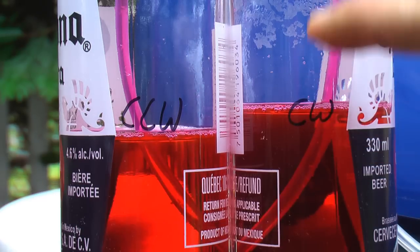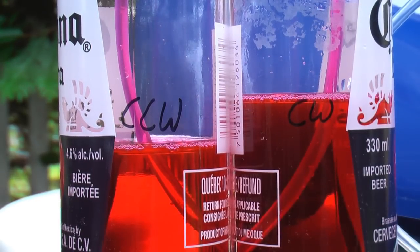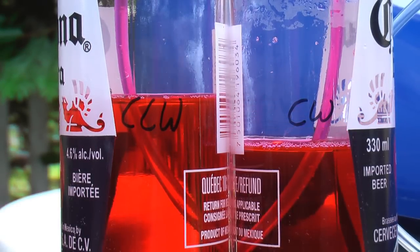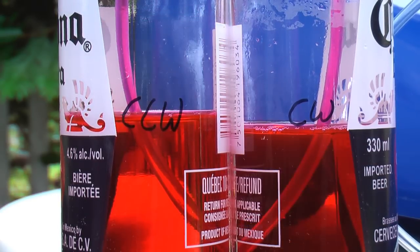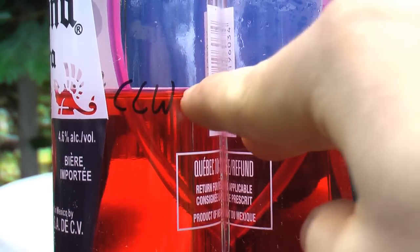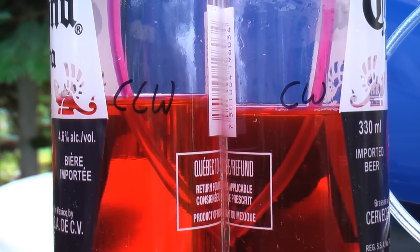I just shut the bike off, but you could see the clockwise one was rising super fast, which tells me the carbs are a fair bit out of sync. I'm going to give the synchronization screw a counterclockwise twist and see what that gives me. All right — now the opposite thing is happening, counterclockwise is rising, so I'm going to give it a clockwise twist. I think that's about as good as one can hope for — the water levels are a little different but they're not changing, maybe a quarter inch in water. I'm going to call it a day and tighten that down, then take it for a ride.